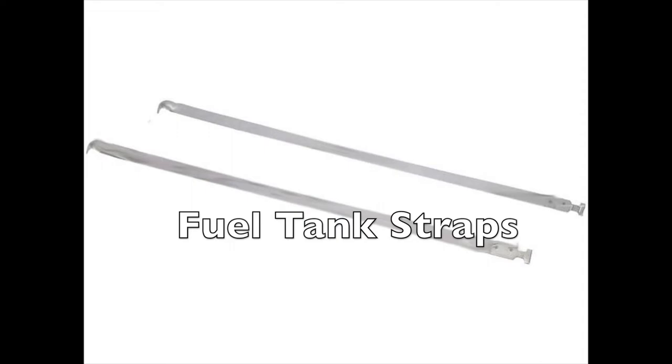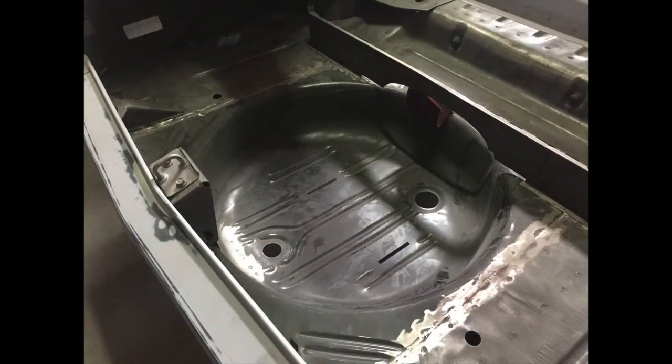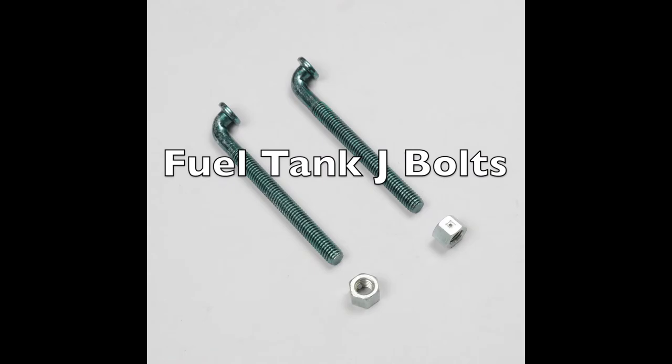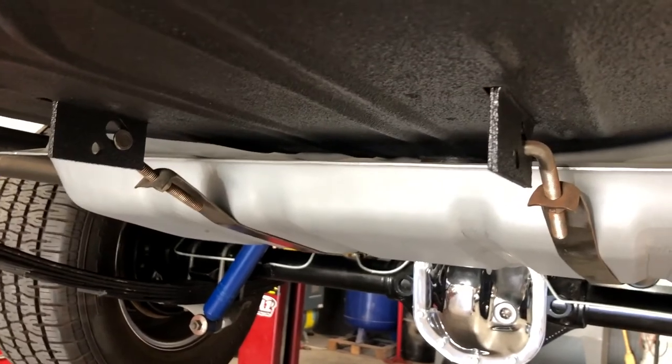The factory service manual says you can install the filler tube with the tank in the body. First attach the mounting straps — put them in sideways, turn the end, and let them hang. Slide the tank under the car and lift it using a jack with a wood block to balance the empty tank. You can only rotate and tilt the tank so much due to it conforming around the spare tire well. Hold in position, then raise the retaining straps and thread onto the J-bolts. Install the nut and tighten to not over 50 inch-pounds.